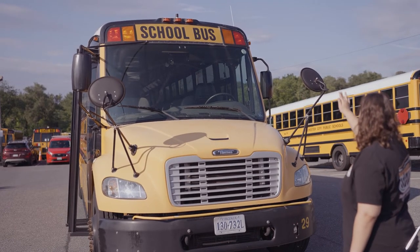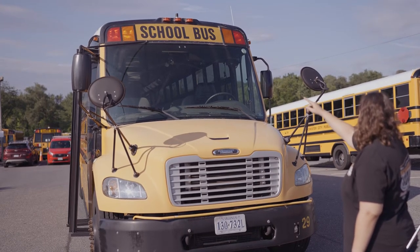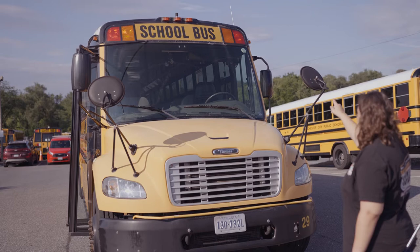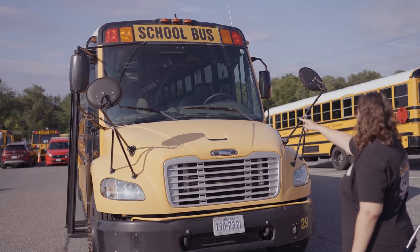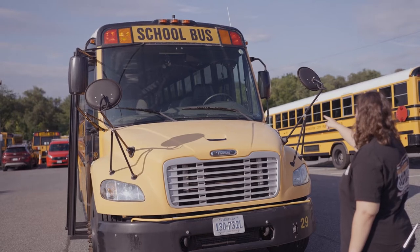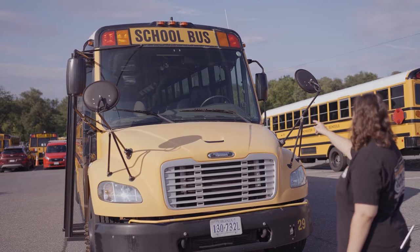My windshield is securely mounted. Its seals not worn, torn, frayed, or burnt. It's not chipped, cracked, or broken, and has no illegal stickers. My windshield wipers are securely mounted, not missing any nuts, bolts, or screws. There's no visible sign of dry rot, and I'll be testing the tension when I'm in the bus.